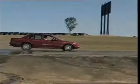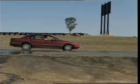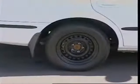This section examines the proportioning valve. It divides up the braking effort applied to front and rear wheels under heavy braking according to how load is distributed across a vehicle. The effectiveness of braking force is determined by tyre to road friction, and this increases as load increases. Applying the brakes causes the front of the vehicle to dip, creating greater tyre to road friction on the front tyres and less on the rear — a change called load transfer. So if equal braking force is applied to the front and rear wheels, the smaller rear load can make the rear wheels lock and perhaps skid. The braking force applied to the wheels needs to be adjusted to allow for changes in load.